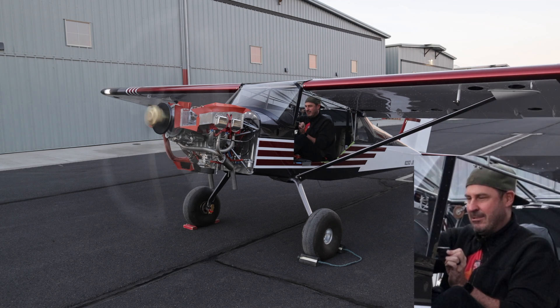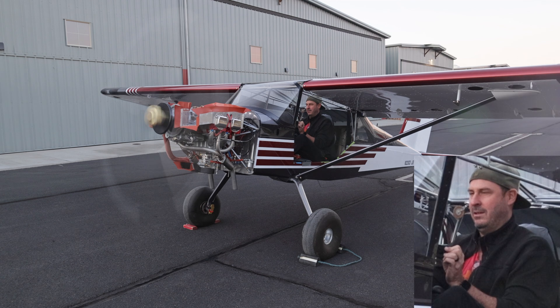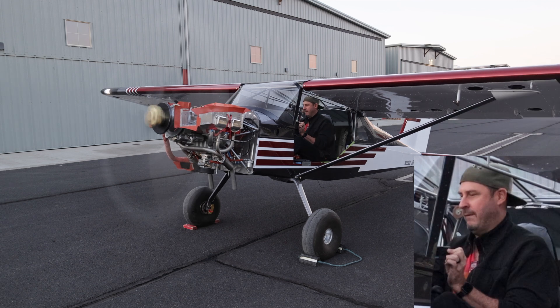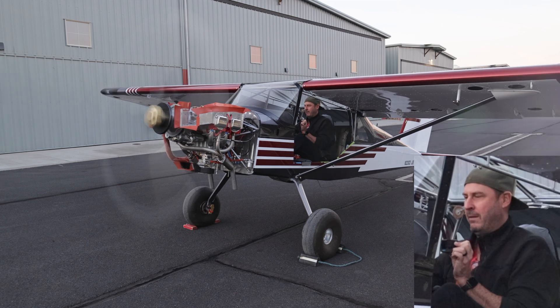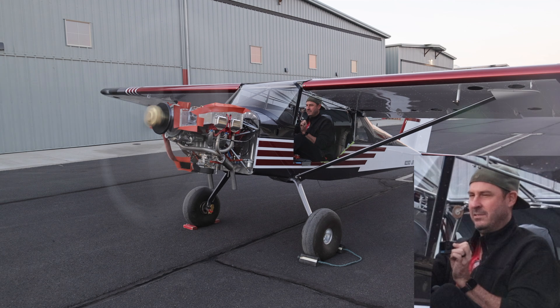The only problem is it's going to require some contortion to get at the light-speed ignition connector on the cold side of the firewall — it's way underneath there. This run was just shy of five minutes, and I did another quick startup to test the warm start, which didn't require a prime. It just started right up on the first blade again. This totally blew me away, since my Bonanza does not love warm or hot starts, though I'm getting much better at them now.